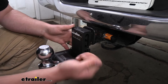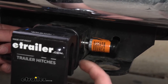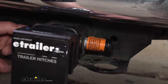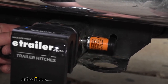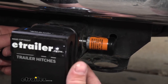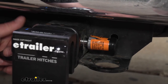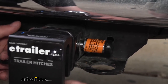It's a really surefire way to keep whatever you have plugged into your hitch protected. One thing I like about this setup is it's going to be nice and tight against the side of your receiver. There's a little bit of space there — if it were any tighter, it would be really difficult to get the lock cylinder on. But with that little bit of space, it would be really difficult for someone to get a tool in there and cut it. It is possible, but you'd have to exert a lot of energy and effort. On top of that, this is made from hardened steel, so it's super hard to cut — that's kind of the point of the lock. You want it to be reliable and more or less indestructible.